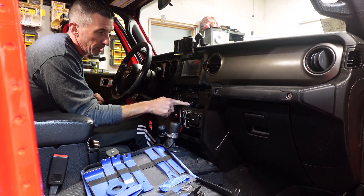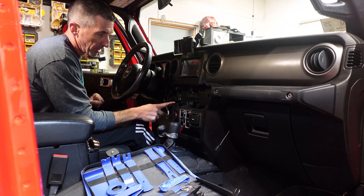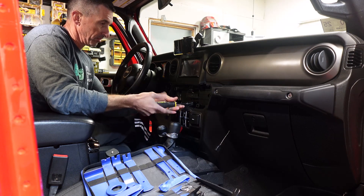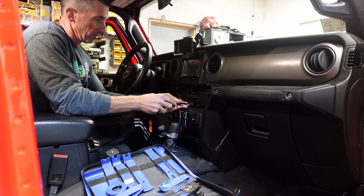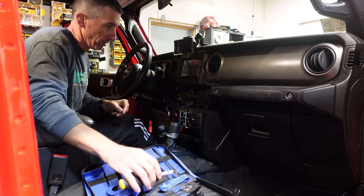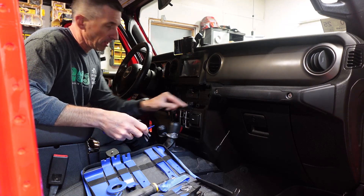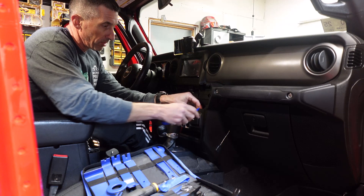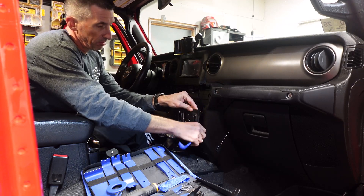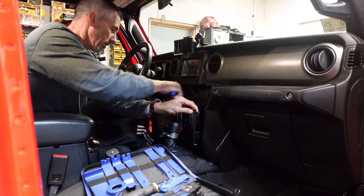Next, you need one Phillips head screw here — take that out, then work the edge of this bottom console to get that out. Hang on to the screws and put them in your cup holder so you don't lose them. Repeat kind of the same process as the top: give it a tug in a corner, and once you find one of those corners to give up a little slack, get your removal tool in there, turn it like a key just a little bit at a time, and the clips start coming out.